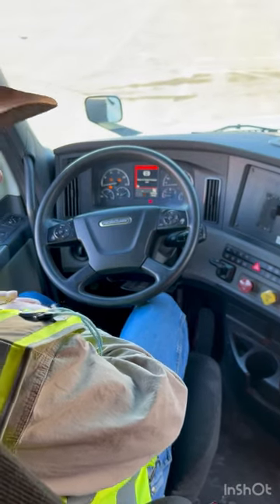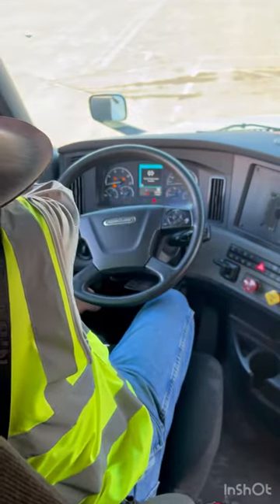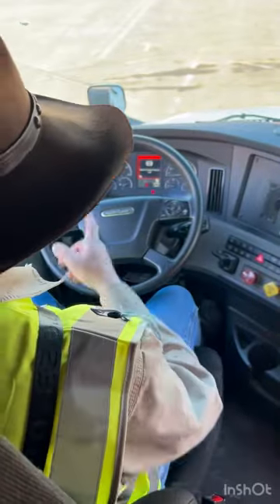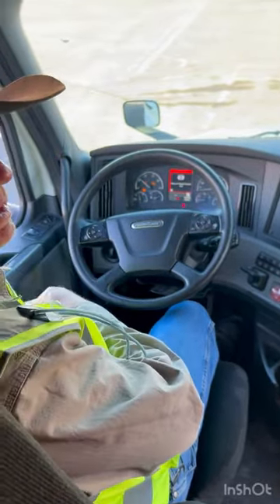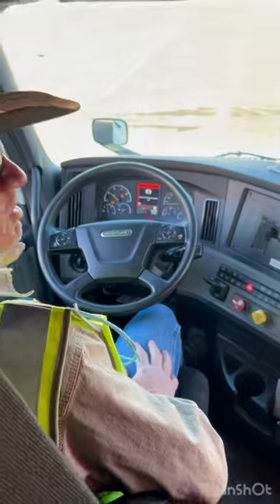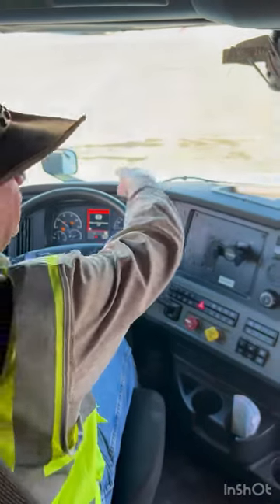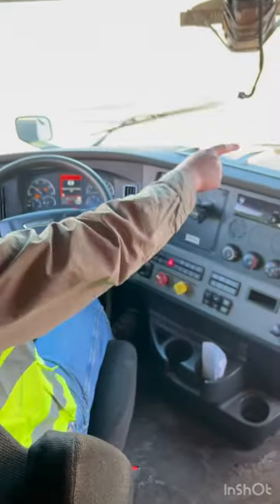To do my tug test, I need to build my air pressure back up, so I'm going to do another safe start. The ABS light on my trailer just went on and off. Start my truck. While my air pressure is building up, I'm going to finish my in-cab inspection. Over on my side I should have a fire extinguisher charged in the green, securely mounted. Back behind me on the side box, I have at least three red reflective triangles and enough spare electrical fuses to operate my tractor. My mirrors are all securely mounted, not cracked or broken, clean and clear of debris, and adjusted to me. My windshield is securely mounted, not cracked or broken, and clean and clear of debris. My windshield wipers are securely mounted, not cracked or broken — the rubber blade is not worn, torn, or frayed — and they do work. My washer pump also works.